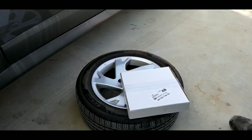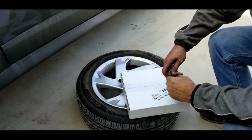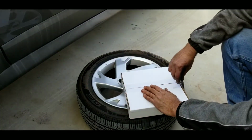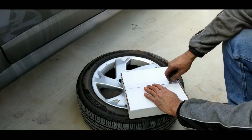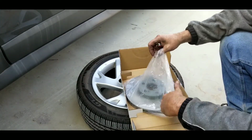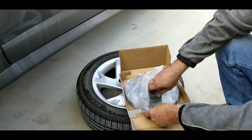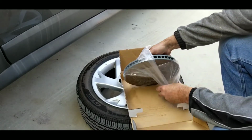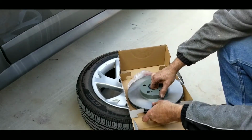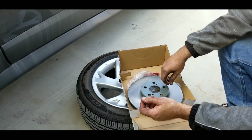So got some brand new rotors. I just like to put new ones on. Usually if you get ceramic pads, you get new rotors. Most of the time that's a good idea. It's up to you. Getting a machine sometimes is more hassle and time than it's worth. The amount of money, because it costs you, say, about half the price of a new one.